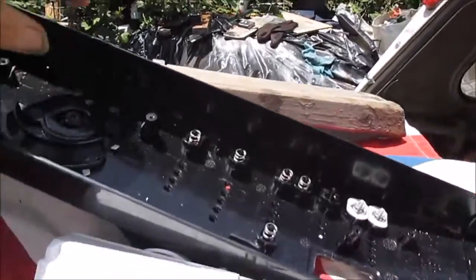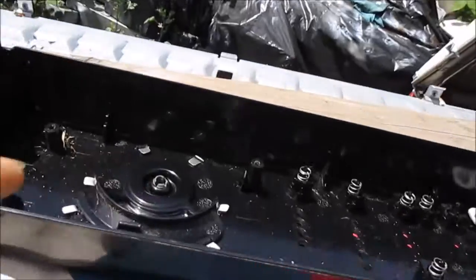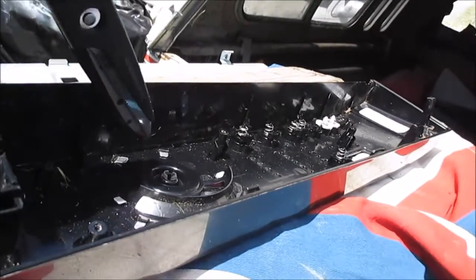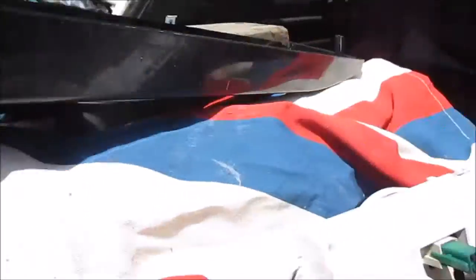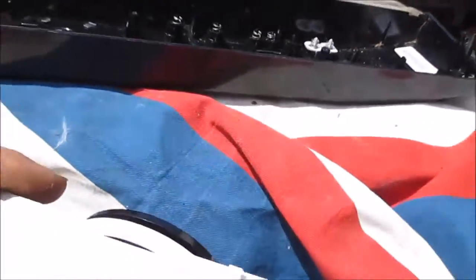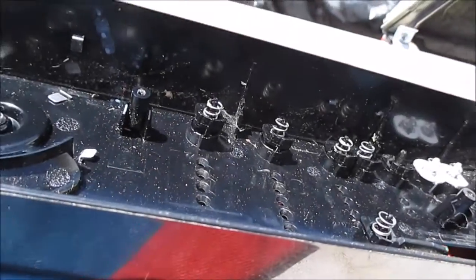I started taking it apart. When I took it apart, all these little springs pop loose — these things just pop out of here, so they're pretty tricky to deal with. If you take this board apart, just leave this part face down. There are little clips you can see in there that hold the board in. Remember where your timer knob is so that you can place it back correctly. I set this one up at the top, dead center spin cycle. When I pull that face off, all the little springs popped out and all these little things came loose and fell all over the place. So if you take this board off, make sure that part is face down to save all those little doodads in there.